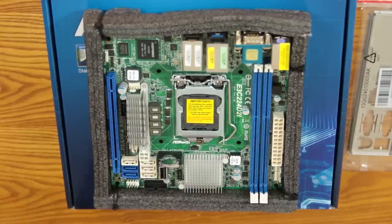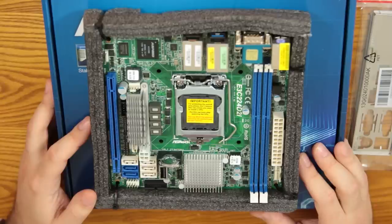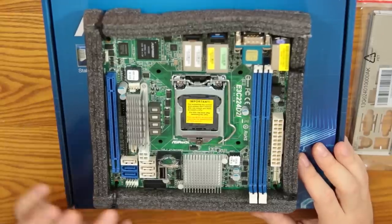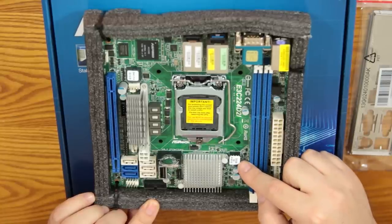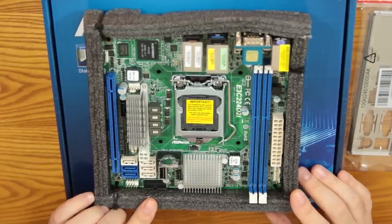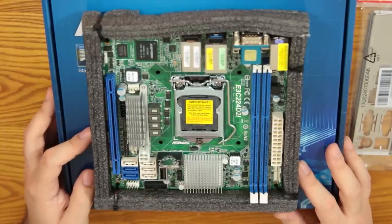Of course there's a battery — I almost unplugged it taking this out, so be careful. Other than that, it's your usual allotment: headers for USB 2.0 and USB 3.0, all your connections for front panel connectors. There's also what looks like a removable BIOS chip, which is good — if you brick your BIOS, you can get another one sent to you, pop it out, pop a new one in. That's pretty much the majority of what we're going to be worried about for this build.